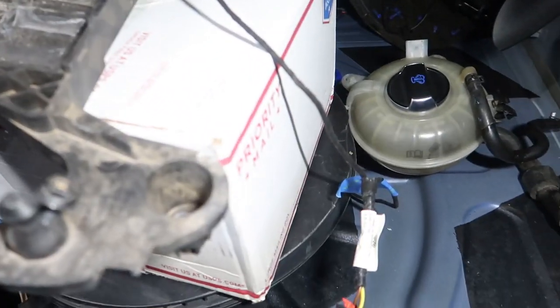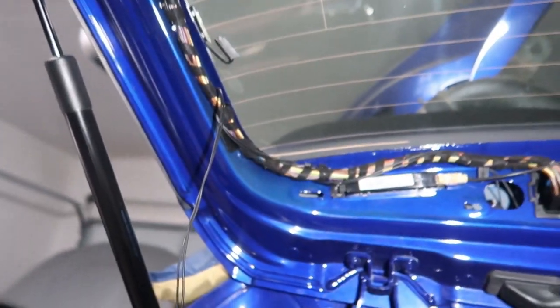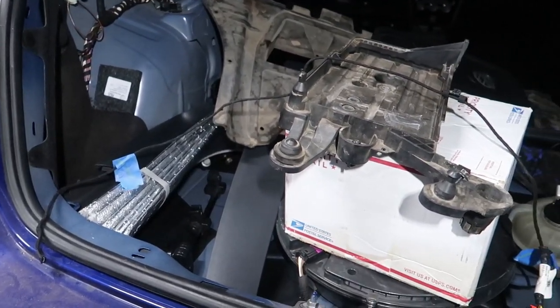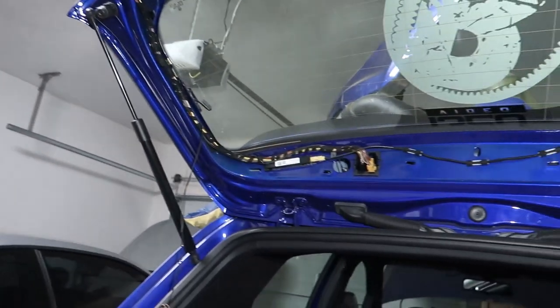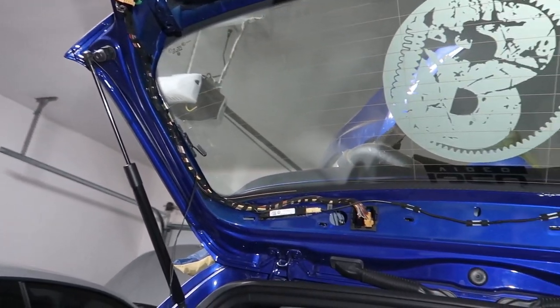I pulled off this part of the wiring harness - it goes to this heater module, the little strips that go across the windshield, same thing on both sides and loops around the inside of the glass. I'm labeling everything - tail light stuff is obvious but I want to make sure. I'm about to pull the hatch inside and lay it on the couch, then go back and forth transferring things. I might take the tail lights out now so I can see how they fit. The rest of the wiring looks all connected so we'll see.